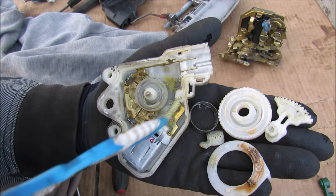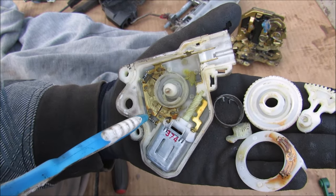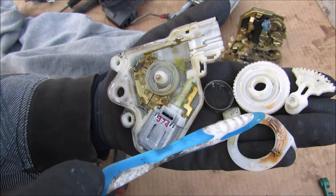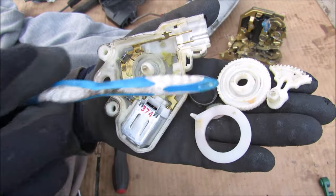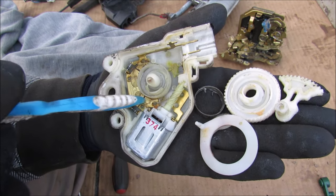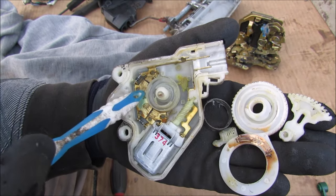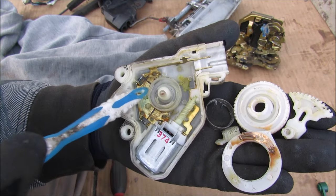The motor is powered by a little internal circuit containing two diodes. Diodes act like one-way valves for electricity, and these are facing opposite directions. With positive polarity current flowing in, it goes through one diode and waits for a bridging piece to connect two contacts. This piece is locked to the quarter gear and reflects the position of the lock itself. If it's in the unlocked state it bridges the gap, turning the motor, which turns the helical gear against spring pressure and moves the lock to the locked state - shifting the contacts to bridge the gap in the locked position, creating an open circuit and stopping the motor.